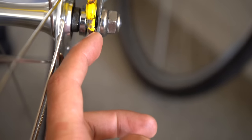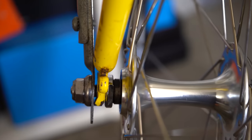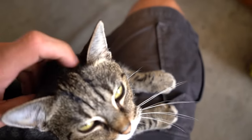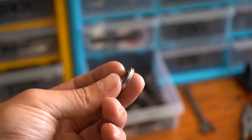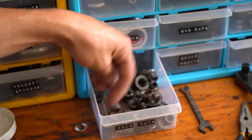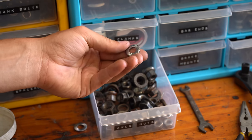I've just fitted the rack and noticed it's not sitting flush on the dropout because of these little tiny safety notches on the bottom of the dropout. If I tighten it down now it would probably bend the rack arms, not sit well, and be a little sketchy. So I'll try and find some spacers to fill the gap. I found one that looks thick enough — and looks like there's a matching one too. Perfect.